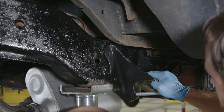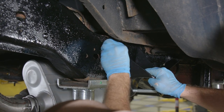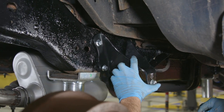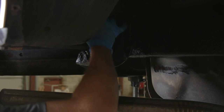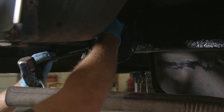I'm gonna install the same thing — the forward leaf spring bracket on the passenger side — because you're gonna really have to install both leafs relatively at the same time due to the solid axle. New set of rear leaf spring shackles to go along with our forward leaf spring mounts.